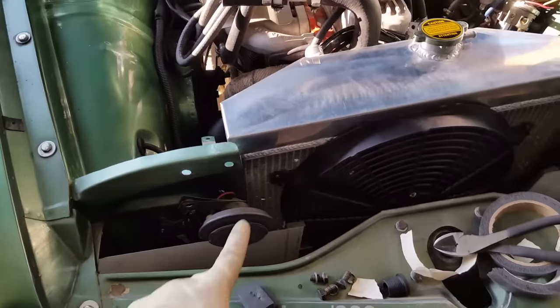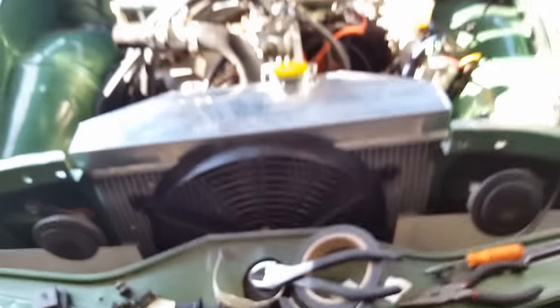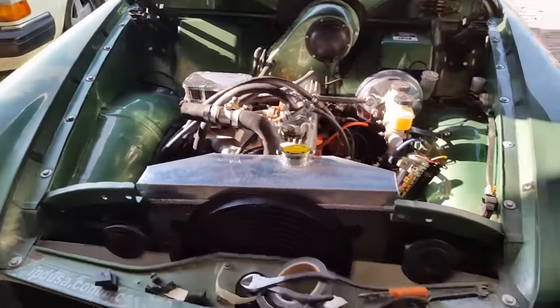Lots of places where it's touching — obvious one here, along the bottom, on the right, and up here as well. I put some nice foam on it — should keep things solid. The important thing is you don't want a radiator rattling around. Anything it rattles against will eventually put a hole in it.